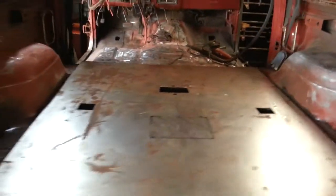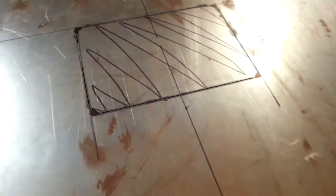We did some more painting on the frame rails since they're easy to get to. Now we're gonna weld in the bed — finally it's all sized. I did cut a small area for the fuel pump. I didn't cut all the way through but I marked it; I'm gonna fill that in with seam sealer, so if we ever have to replace the fuel pump we can just make a couple little cuts and pop it right out, no problem.